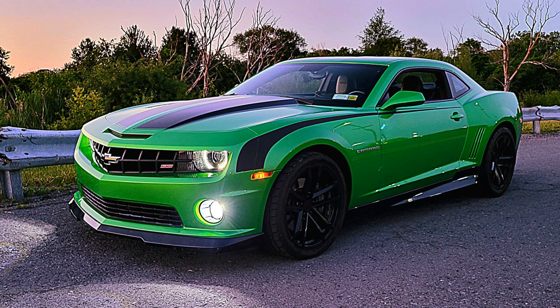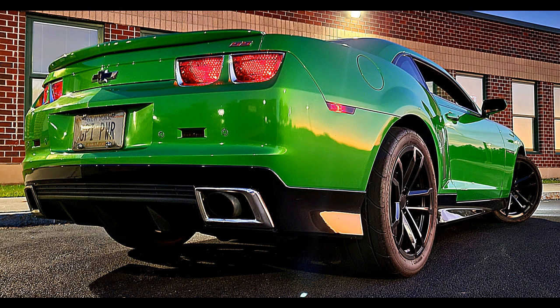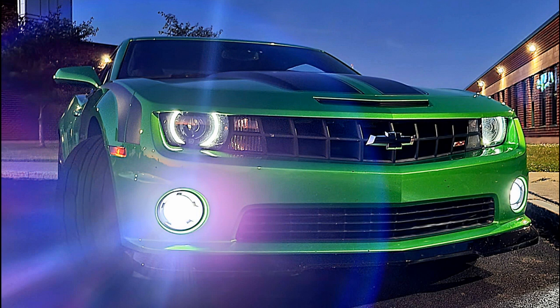Let me tell you just a little bit about the car. This is a 2011 Camaro SS manual transmission. It has the GPI Max Package 2.0 in it, as well as a McLeod RXT clutch. We've got 410 gears with solid bushings. You will hear the rear end making noise in this video, which is totally normal with a solid bushing setup like that, and it's going to help illustrate the drivability a little bit as well. We've got the LSXR intake manifold with a 103mm throttle body on here. The Max Package cam has got 21 degrees of overlap at 50 thousandths lift — that's a couple more degrees than our SS3 and SS4 no-fly-cut cams for the LS3.